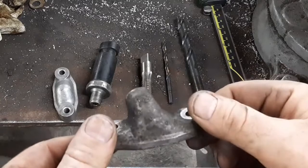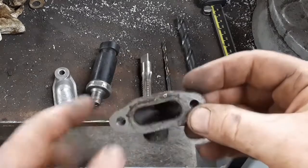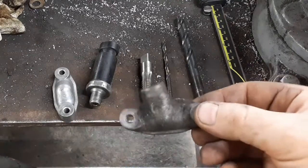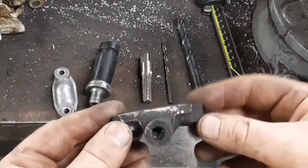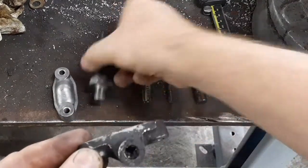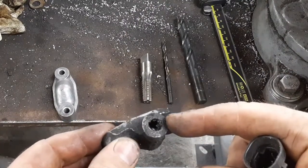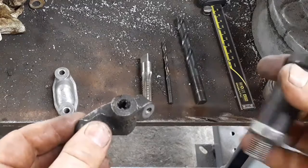There's a third option where some of them have the oil cooler attached. I think most of these are the Tahoes that I've seen — where it's not used but it has the boss on it. These are what I like to use, and all you have to do is drill and tap this for whatever NPT fitting or other fitting your pressure sensor might have.